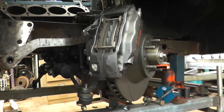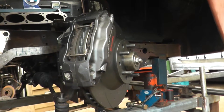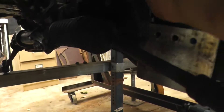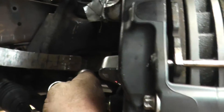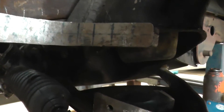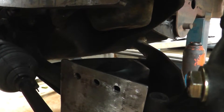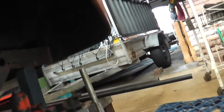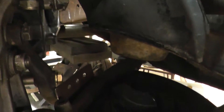The upright is on the truck now, and I'm pretty confident this thing's going to stop. With the sway bar, that will link up with the bottom control arm — and there's no binding, it misses everything. It misses the bottom steering arm and all that. So that's good.